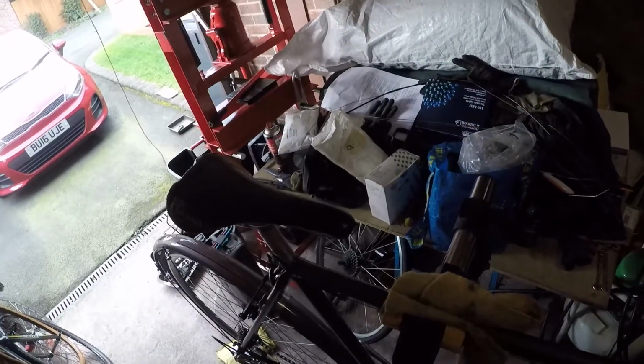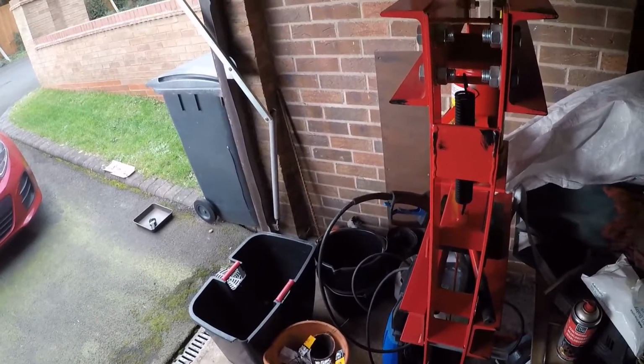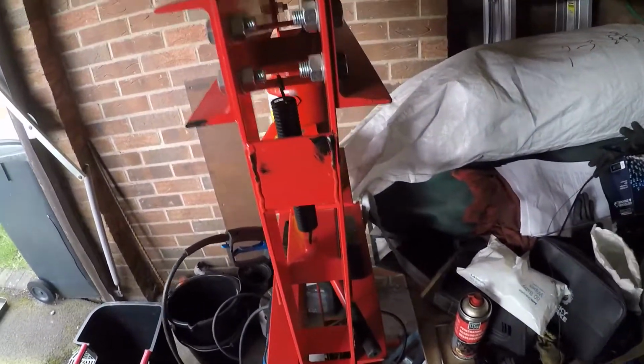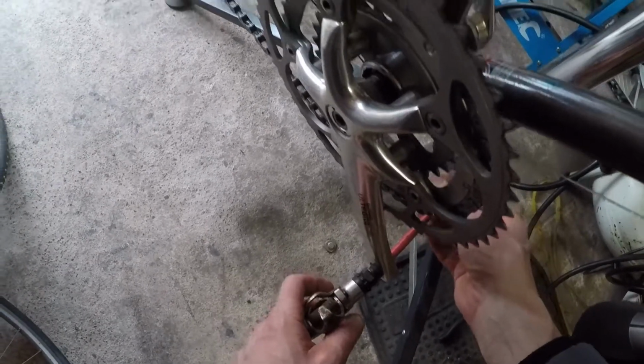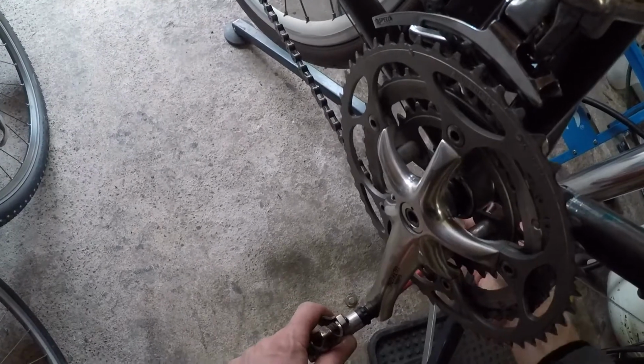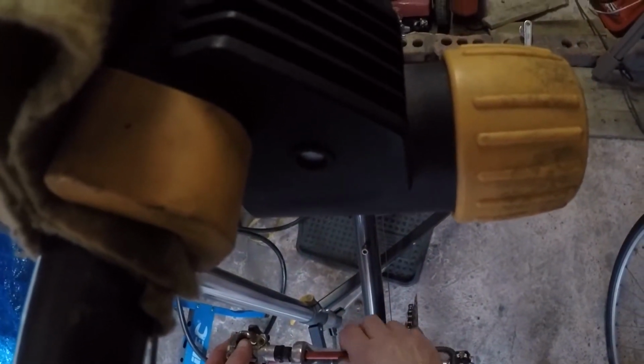Right, so that's this side. Drop of oil. Allen key or 15mm pedal spanner through from the other side and forwards. Let's see if I've still got the right one. Right, yep, should do. There we go, that's it. Nip it up. Then we'll nip that up properly when it's on the floor, it's easier to do. This side, forward again, there we go, straight in that one.